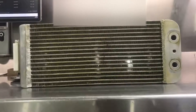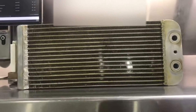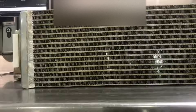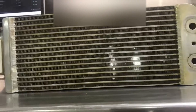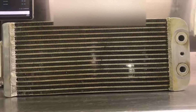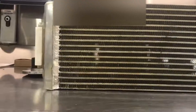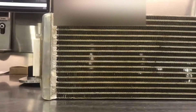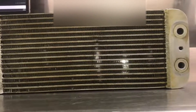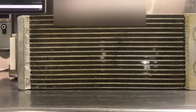Here's the Magnuson intercooler brick. It's not terrible, but it's not very dense — the fins have a decent amount of spacing between them and you can pretty much see right through it. That's one area they could improve, because the fewer fins you have, the less heat transfers from the supercharged hot air into the intercooler fluid.